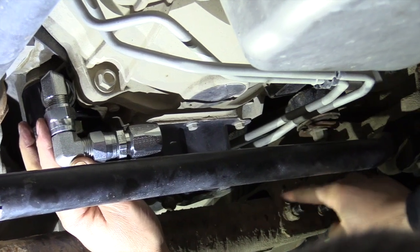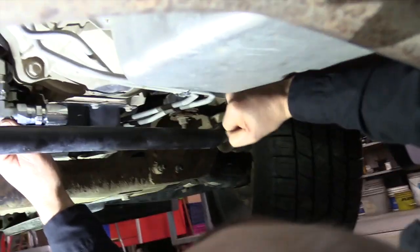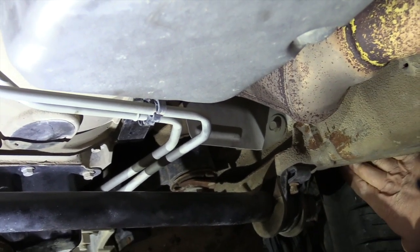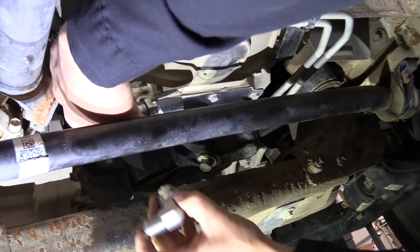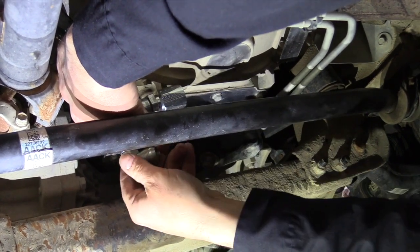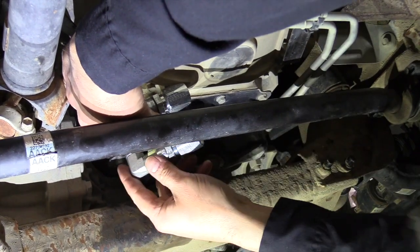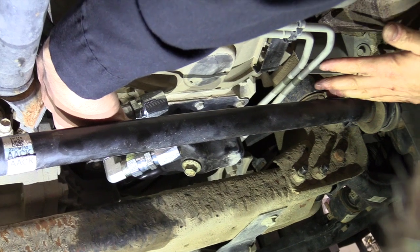A lot of it has to do with the angles it's throwing me at. By the time we get that hose on there, it's throwing me back here and I've got to figure out how to get where my hoses need to go. There's going to be a line support bracket right here and we're going to sneak through by this rod and up along the outside of the frame. We want to stay away from those catalytic converters because they're going to be running probably 800 to 1,000 degrees — we don't want to be running those hoses anywhere near that heat. Going on the outside of the frame, this configuration is just not giving me a nice angle to get where I want to go.